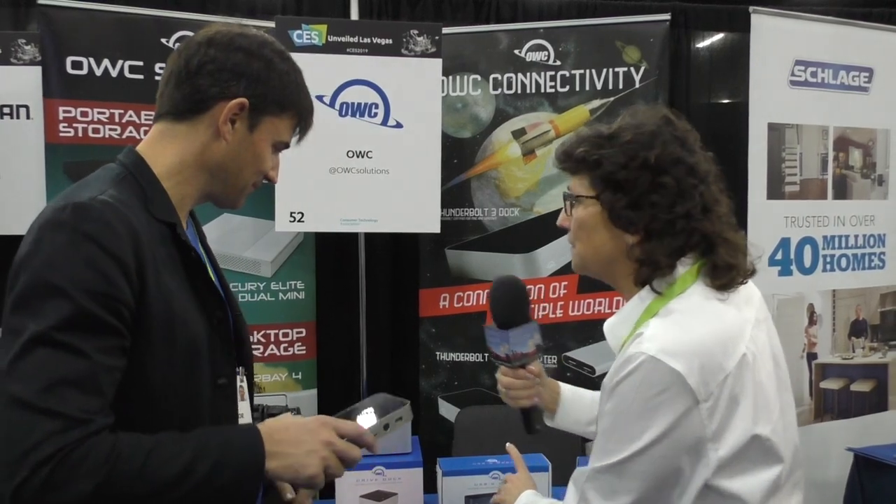I use a MacBook Pro with an 85-watt power supply. Can I still use the 60-watt dock, it just takes longer? Correct. Your computer can take 85 watts, but it's happy with 60 as well. I tried charging my MacBook Pro using the charger that came with my new iPad Pro and it worked — it took all night, but it worked. That's like 20-25 watts, much slower than this. So this is our OWC USB 10-port dock — it gives you 10 ports of great connectivity. One cable connects you to 10 ports of the world. But this is not a Thunderbolt dock.